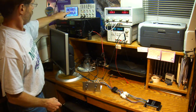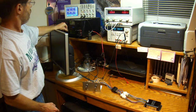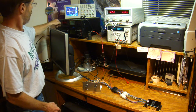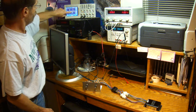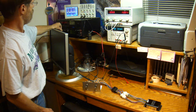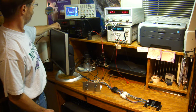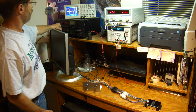You can see the effect of the VersaFueler output if I rev the engine up. And if I change the duty cycle — we've got a pretty long pulse width here — let's change it to a shorter pulse. Now you can see we have a very short pulse, probably about what you'd see at idle. Let's put it back to the long pulse.